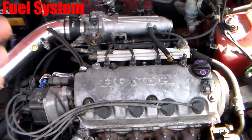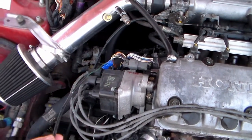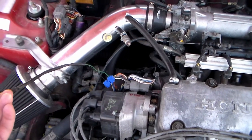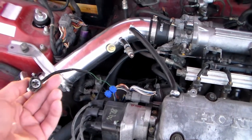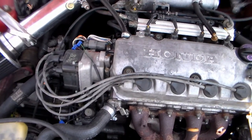The fuel injectors are 235 cc flow rate. Of course, you won't be using your VTEC anymore, so you're going to have stray wires. You can chop them off or just tuck them. Ours were actually chopped off at the harness because the last person that had this car thought it would be a great idea to butcher the harness. So I quick-connected a VTEC harness on here for later, in case Angie wants to upgrade this to VTEC later.